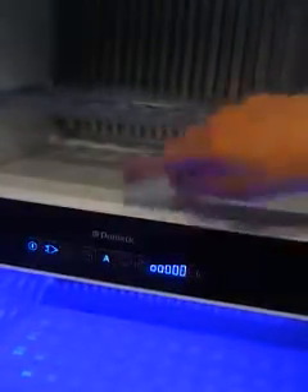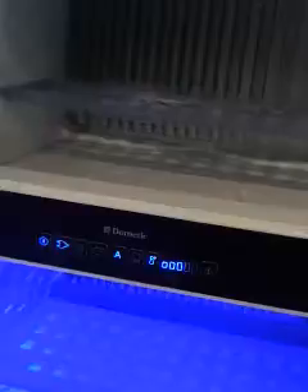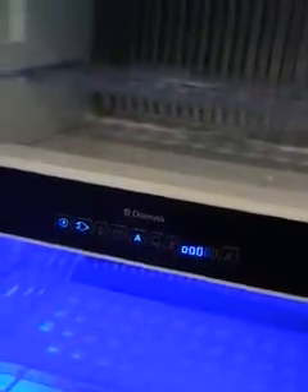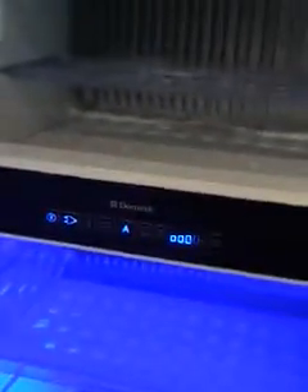This side of it — you see all five bars lit, that's the coldest the fridge is going to be. The freezer is different. So if you're getting frozen butter out of your fridge it's too cold — reduce it down. Obviously it depends on the temperature outside; if it's really hot outside it's going to need to work harder. The button next to it is to do with the freezer box — in summer you can get condensation around there and it can freeze the door shut. Press that and it will warm the edge of the door to release it.